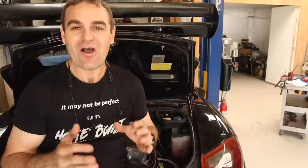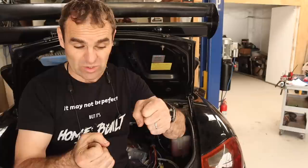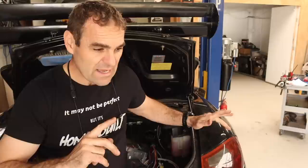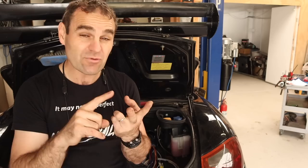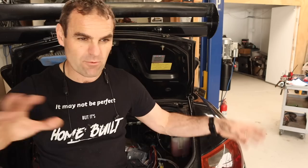Many of you will be aware that in the previous episode, and actually ever since I've got this engine in this car, I've had issues with it overheating and the thermostat is not opening. I know it's not opening because the aluminium lines going to the front of the car - both of those cooling lines - are completely cold. Even when it's getting up to temperature, I can tell the thermostat is not opening at all, because those lines are still cold to the touch and they would heat up instantly as soon as hot water was going through them. I did pull the thermostat out previously and checked it in a pot on the stove and it opened as it should. The water pump could be an issue, but this engine came out of a working car.